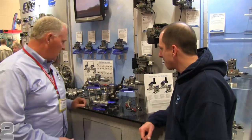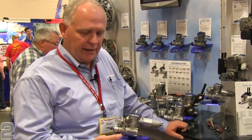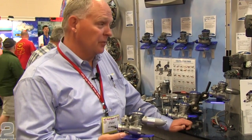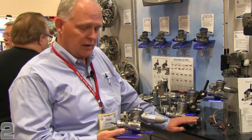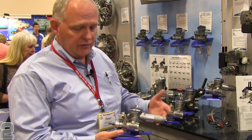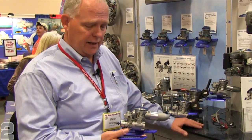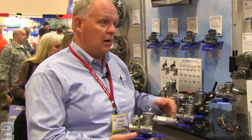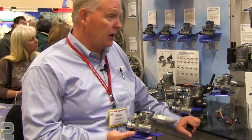We've moved around the corner and we're talking with Peter Burstrom about the new engines from Horizon. Back in December they released the 10cc engines from Evolution, to great acceptance from customers. It's designed to fit inside 46-size airplanes and runs a huge range of props, anywhere from an 11x7 all the way to 13x8s and 14x4s. Guys are finding it very useful for real 3D profile-type airplanes or lightweight airplanes, or with a slower prop for lower noise to meet some field noise requirements.